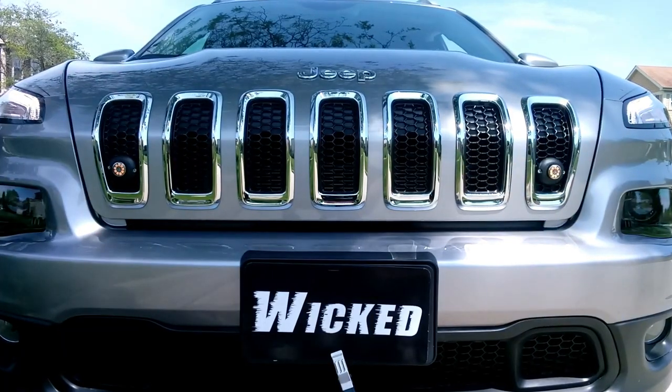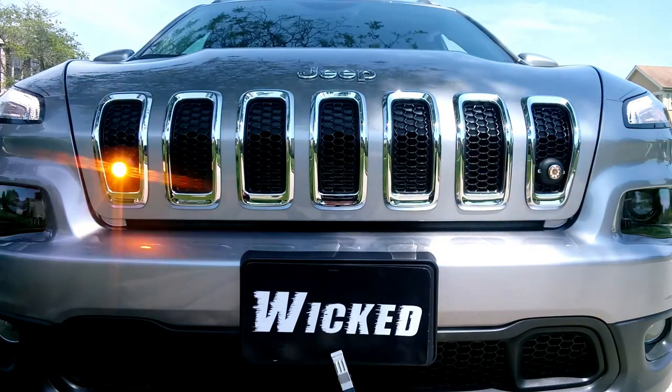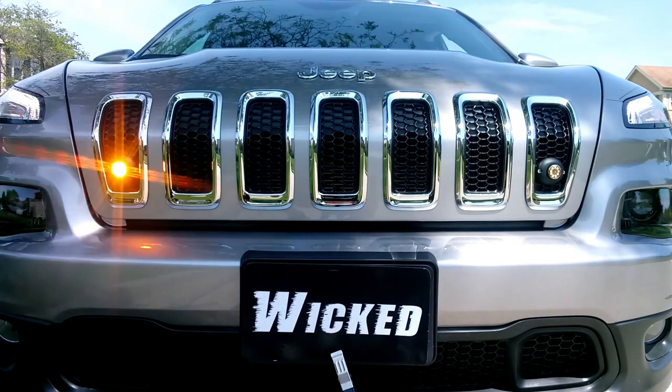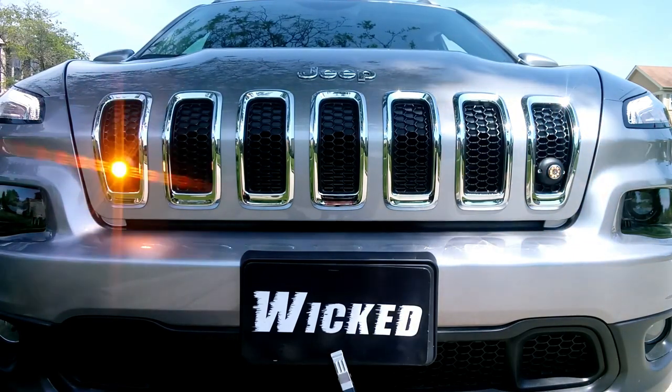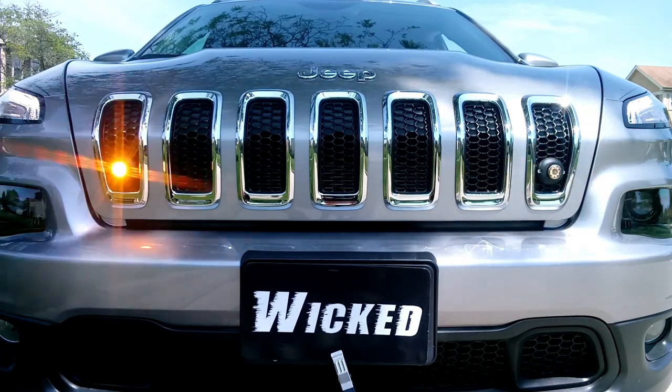Here you can see we went with a very fast double flash pattern alternating. The other reason I picked this particular light is I did try to put a TIR-3 behind the grille, but with this honeycomb grille it was less than impressive coming through. Now this is a budget-friendly build on this particular Jeep — we didn't have a big budget to pour lighting all over it, so we did need to go with something simple and effective on the front of the vehicle.